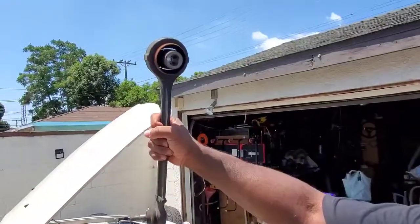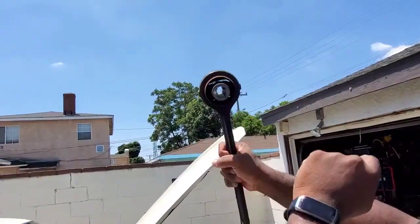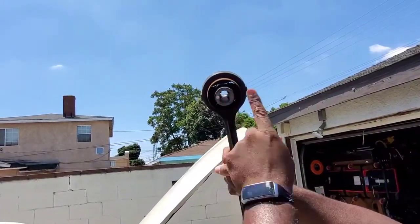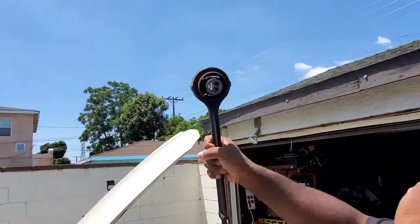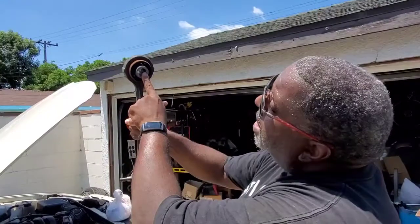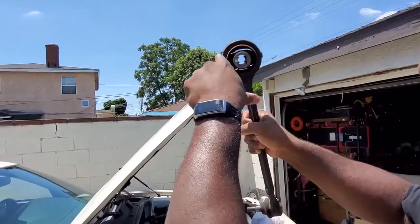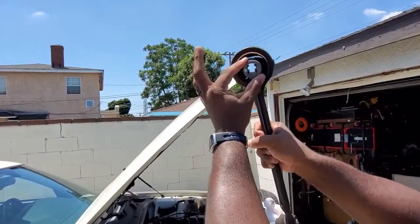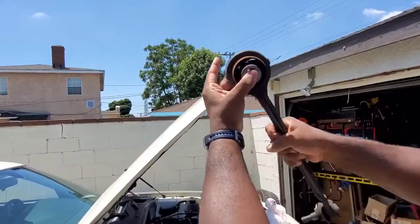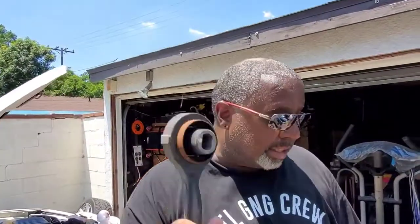Now this one's shot — if you can see through this, it's done. This gives you a lot of knock every time you hit the brakes hard. This is the original bushing they put on it. It's basically rubber all the way around, stuck to the outer frame and stuck to this. Every time you turn the car or go over a bump, you're flexing this rubber and it goes bad. All LX's do this. This is a horrible design, it sucks.